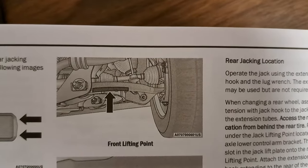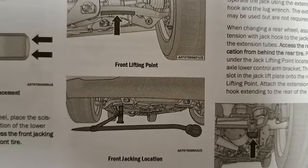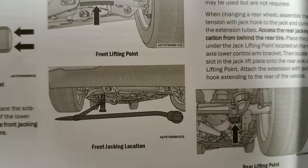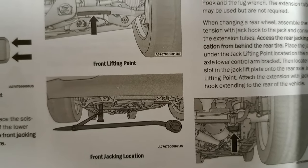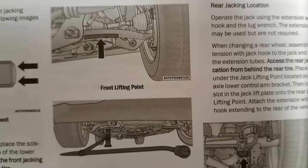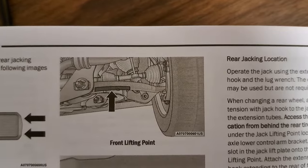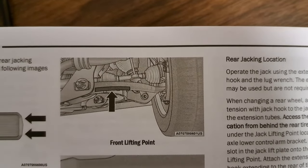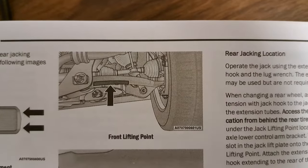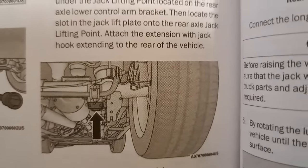As a quick reference, here is the owner's manual diagram showing the jack actually facing the front of the truck. When I say the jack facing, I mean the eyelet so you can assemble your extensions and tire tool. There's not an actual pad there — it's just showing you the general area where to put the jack on the lower control arm. And there's your rear jacking point.